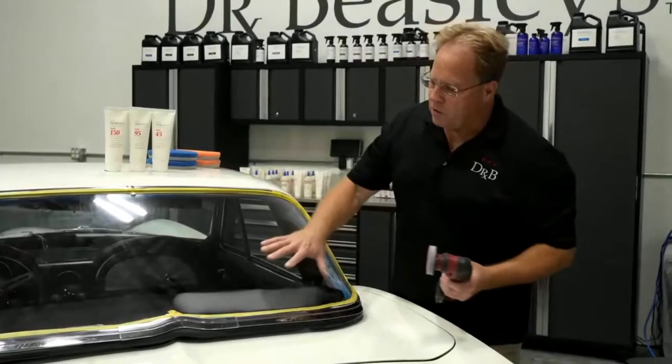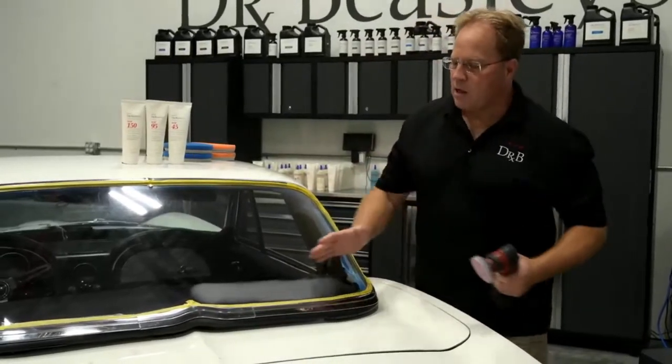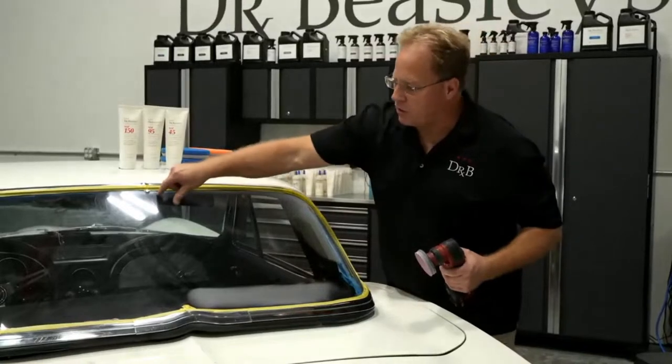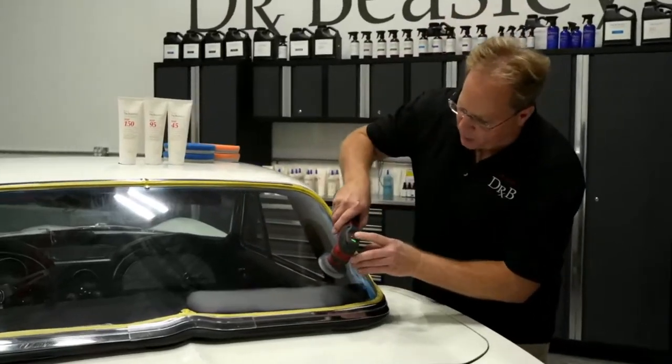So what I'm going to do first is something I teach in all my sanding classes when I teach machine sanding, and that's called edging a panel. I'm going to go around and sand the edges first, then I'll knock out the easy to buff big section. And I'm going to buff this thing all the way up to the 4 setting.